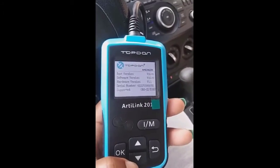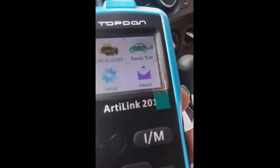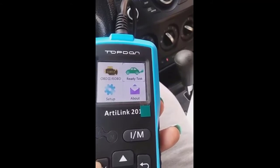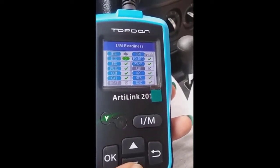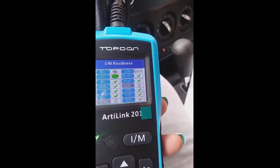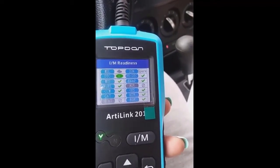I'm going to navigate to the Ready Test. This is kind of like when you go to a mechanic and they plug something in — a lot of shops charge for this. The little symbol emitting from the back might represent a mini emissions test. I'll click OK. It's initializing. The ones with checkmarks look good: DTC, misfire, CCM, CAT. Gray ones aren't supported. Under IGN it shows a spark, and my MIL shows something unusual — so I may have two potential issues.